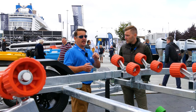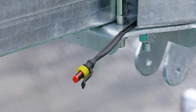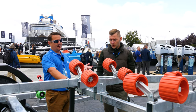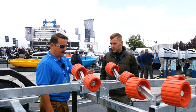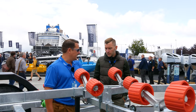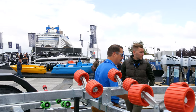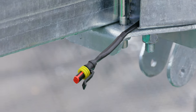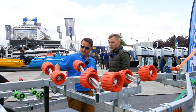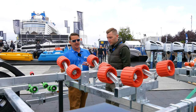All of our trailers, manufactured in the UK, can be used throughout Europe. We have the full European type approval and we issue a certificate of conformity with every trailer we build. Anything wider than 1.6 metres has to have front-facing lights — a bit of a challenge for a boat trailer manufacturer since the trailer goes in the water. We've designed it well though: these LED lights are fully submersible, with internal wiring coming through the chassis and out on a sub-harness connected to a fully waterproof light board. That gives you added visibility whilst towing, and we've always tried to think from the end user's perspective.